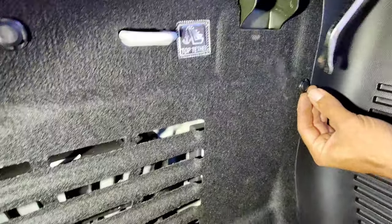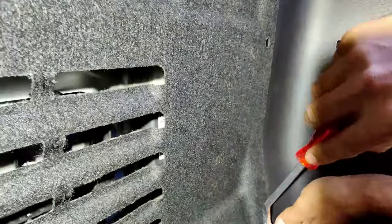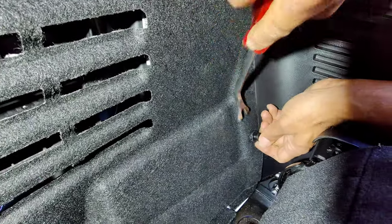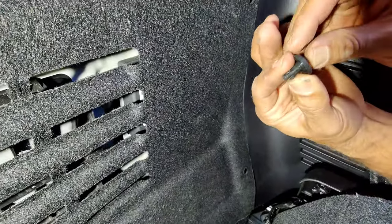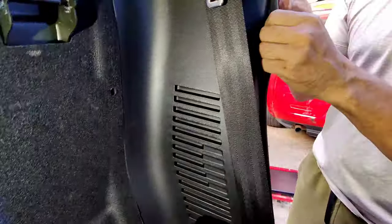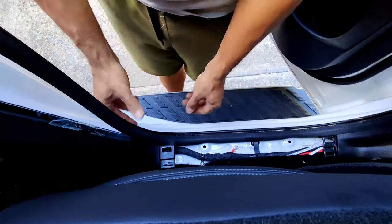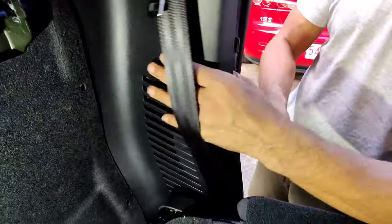So we're in the interior, in the back of the cab. We've put the seat down. We're going to start by removing these off — there's two of them. Remove these clips — you pull the centre out and then it allows the whole thing to come out like that. There are two pieces to it, and that's how they lock and unlock. Then we're going to start moving this whole trim from up here. You start by pulling this back, then you come down here and remove that trim off there. That gives you access, then we should be able to remove this panel — it just pops off like that. Now that panel's all free.